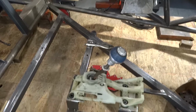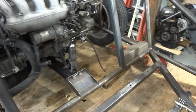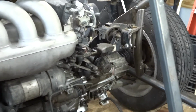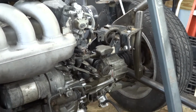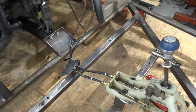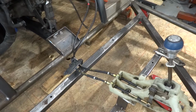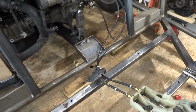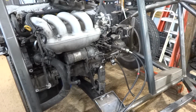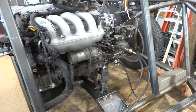So if I put the shifter in the proper way, cables have to come out the front and then they'd have to go back around under through the motor and end up in the original location. But what if, with the shifter in backwards and the cables coming out the back instead of the front, the shift pattern is now upside down? But if you run the cables into the front of the shift linkage at the transmission, now you reverse the pattern at that end. So you end up with the same shift pattern and the short cables will reach the transmission.